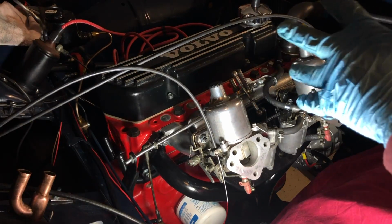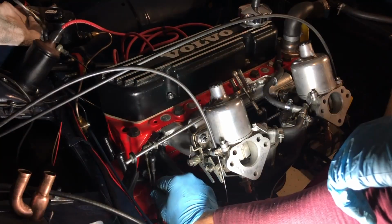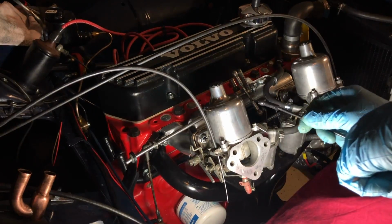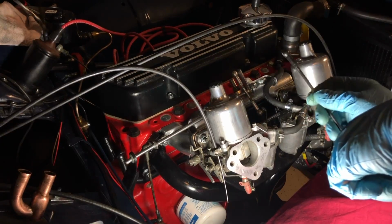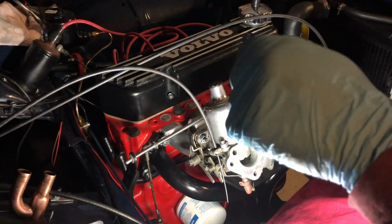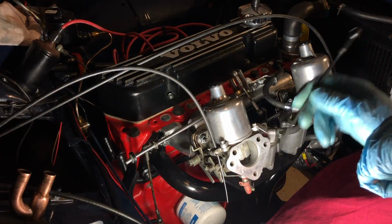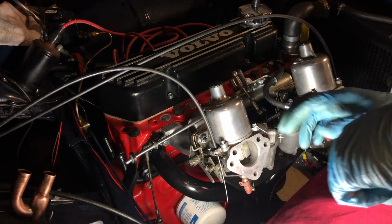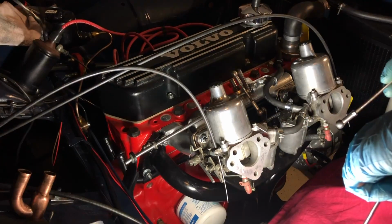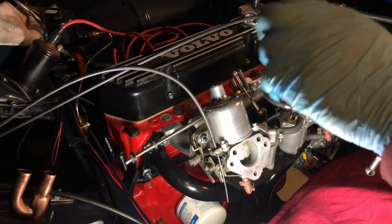It's about 3:30 in the morning. This shaft, throttle linkage, was actually 1 inch too short, and what that was doing was keeping the carburetors from opening up full throttle, 1 full inch of throttle travel, which actually ends up being quite a bit. Could have been that I could only achieve half throttle if I didn't realize that this was too short. And I went through and made adjustments and everything. I adjusted the linkage here that spans the tube. I'm about to call it a night. In the morning, I would like to do all the coolant line plumbing back here.